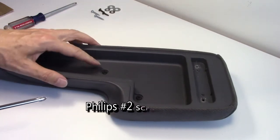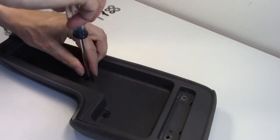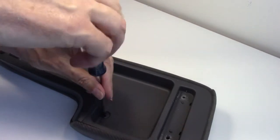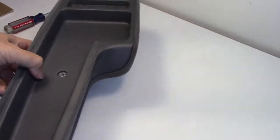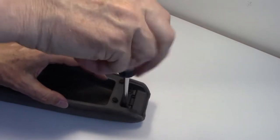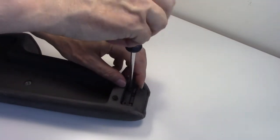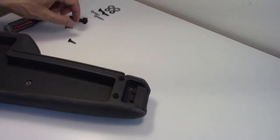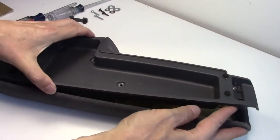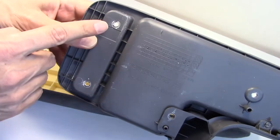What you'll need to do is remove the plastic from the fabric — the shell has to come out, and there are only four screws. Common on Honda armrests, the plastic latch on one end always seems to break, and mine broke off years ago. Take those screws out and you'll be able to lift the shell from the inner fabric layer, exposing where the cracks have begun in your housing.